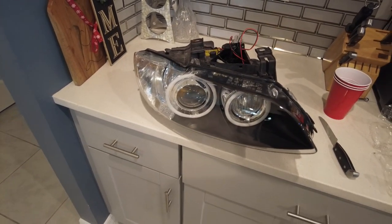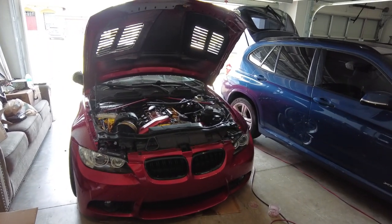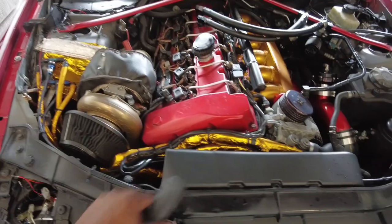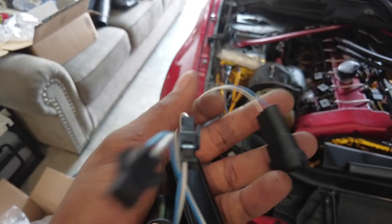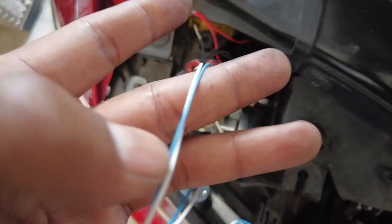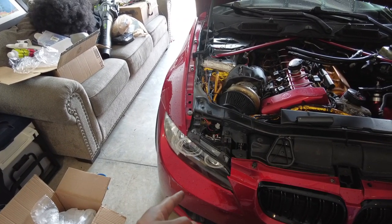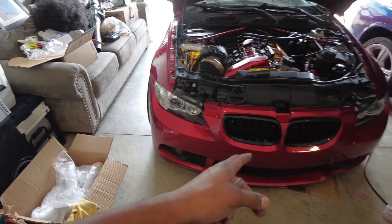One finished product that looks amazing — it looks like I bought a brand-new headlight, and these crazy angel eyes are going to look sick. Now we've got the headlights installed and we're on to the wiring phase. It came with a harness but it's a universal application, so I'm not going to use it. This piece is from my old LED angel eye bulb — I'm going to cut the harness so it plugs into the angel eye plug, and then the blue and white wire I'm going to wire to power and ground. These are polarity sensitive — positive has to go with positive and negative with negative.